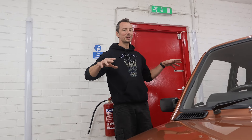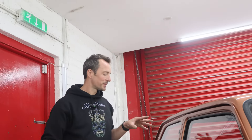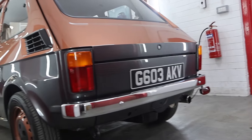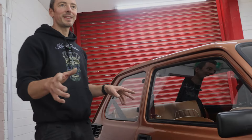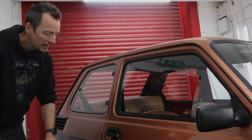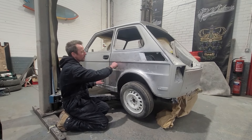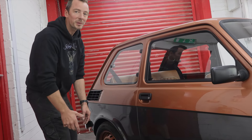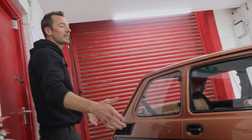Honestly, I didn't think the two-tone was going to work when we first talked about it, but actually I think it works really well. We've got the steel wheels painted up with the bronze, cut that down the body line, and I think it just works perfectly. Starting from scratch in bare metal, we found that both rear quarters had had it — they were shot. We got two new old-stock rear quarters, fitted those, and bought two new doors. The only genuine doors we could get were the later model doors with one-piece windows and no swage line, but the quarters did have one. So we cut the swage line from the bodywork and smoothed it in to make the side of the car look a whole lot smoother — a small modification but it changes it up a lot.